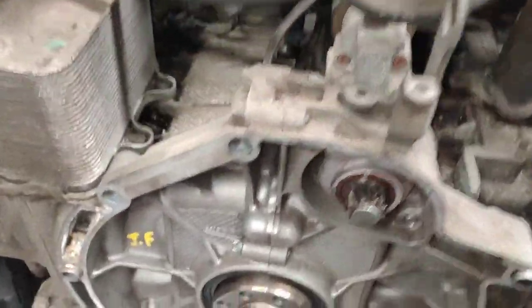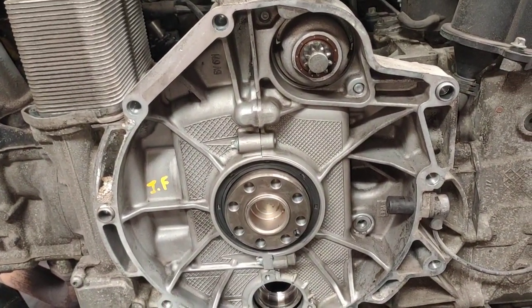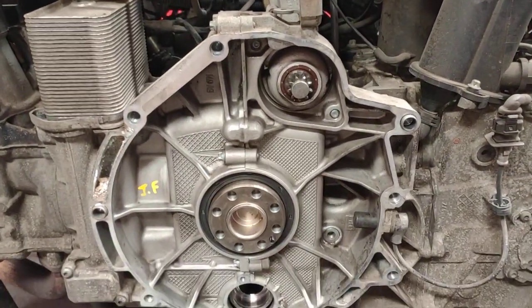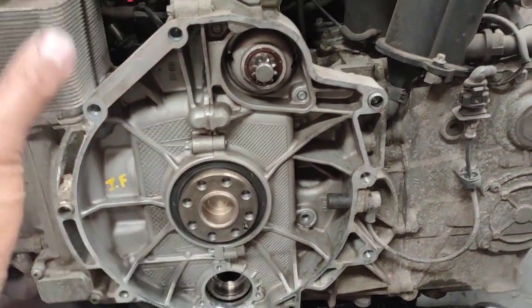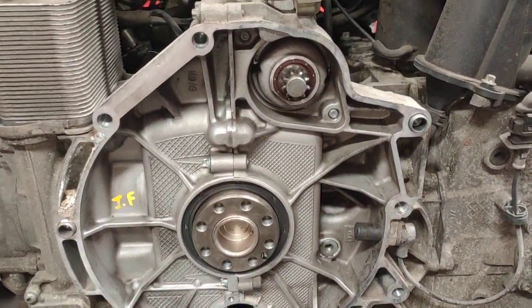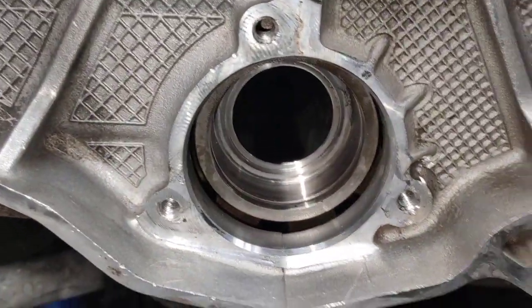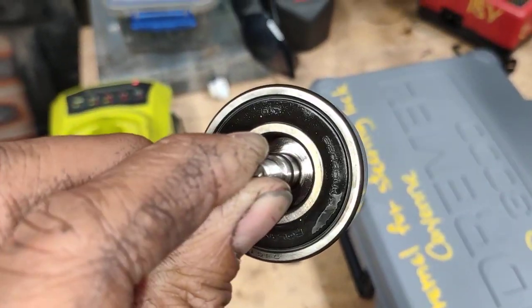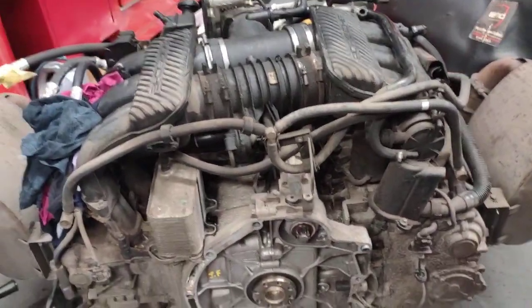This one here is all taken out. I've taken the bearing out. I've got my parts already this week — I've got my flywheel already. I want to get all my parts and just assemble the car and finish it. It's better that way, rather than putting things apart and leaving it open. So I've got the actual bearing out. These are the bearings for that 996 right here. It's still intact, but better to do it now because it's a known issue.